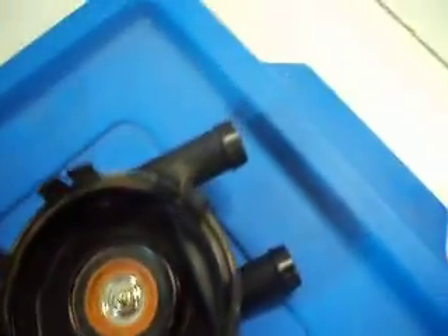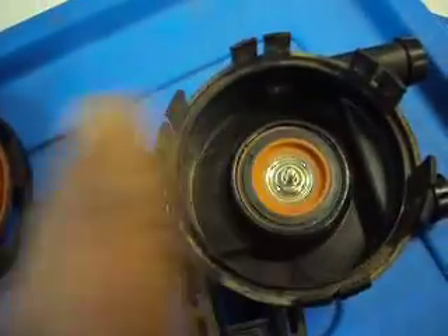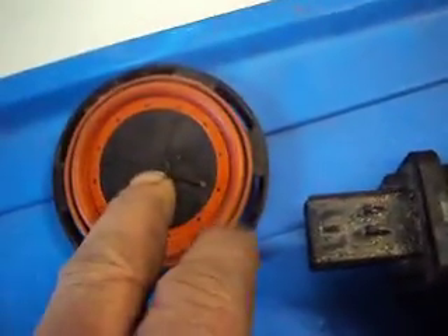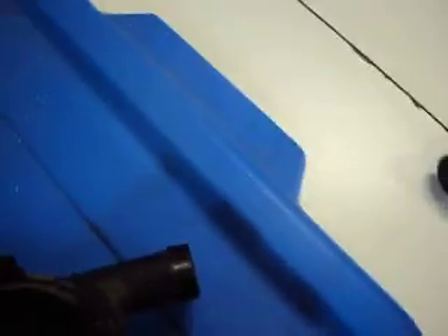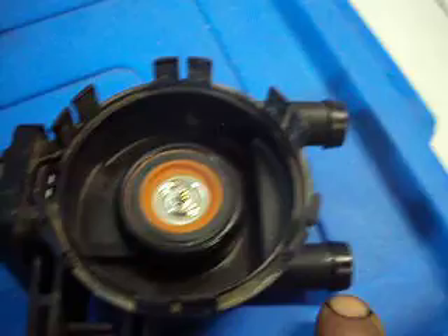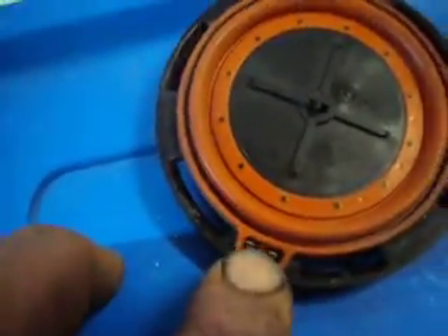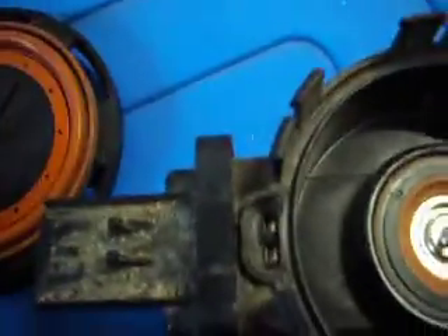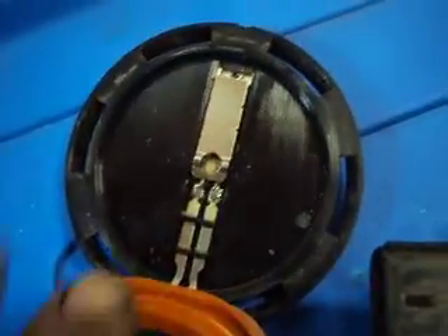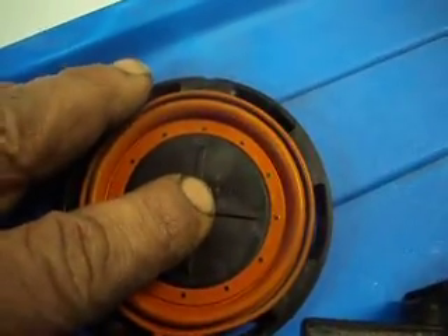I always thought there was a relationship between the switch and when you activate the solenoid, but there really is no relationship. When you do the solenoid test from your scanner, there's no relationship between that functional test of the solenoid and the switch in the top part here. The way the vacuum is routed, it's supplied to the intake port here which goes to the canister vent, and right through where the electrical connection is — where the two prongs from the top part seat in — vacuum goes through there and gets up behind the diaphragm. That's what pulls the diaphragm in to control the switch. It's not the movement of the solenoid that pushes the diaphragm up; it's the vacuum that gets underneath the diaphragm that actually pulls it up and closes it.